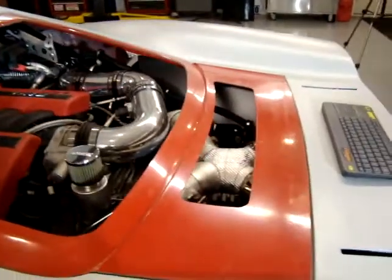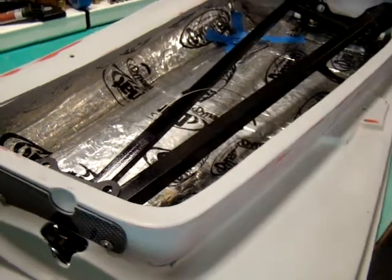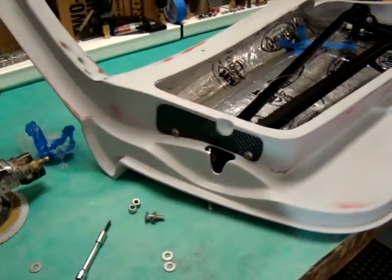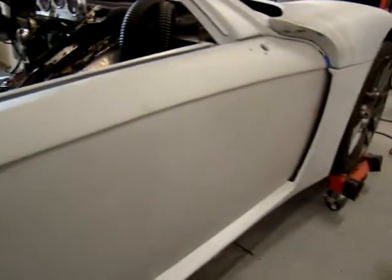And then once you get to that point, you have different color fillers all over the place, and it's kind of hard to really see the imperfections if you don't have a single color. So what I do is I go to the Slick Sand, and I shoot that with, I think, a 2.5 millimeter tip. It's a filler gun that I use with about 55 psi, and I shoot that just like paint. And once you shoot that on, it'll be a somewhat coarse surface at first, but after you sand that down, you'll have a real nice smooth gray finish in this door.